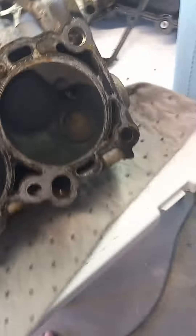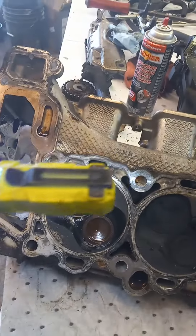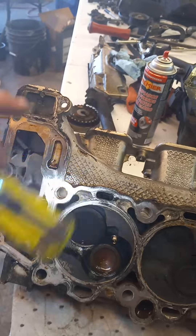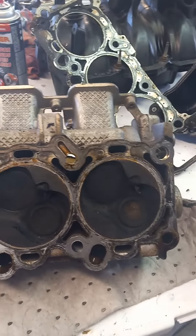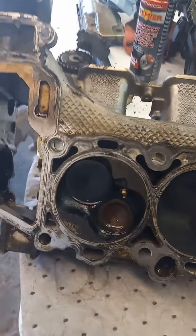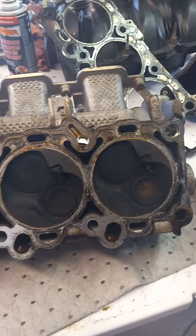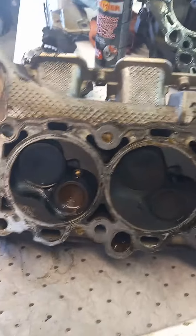I know they said the 3.7's had issues with the springs coming apart and with the valve seats. Let's flip this over real quick. All my valve seats seem to be pretty good. This valve's open a little bit because the lobe's down, but it did not hit the piston, so we are good to go on there. I'll see if I can locate two remanufactured heads, or one, or send one out.